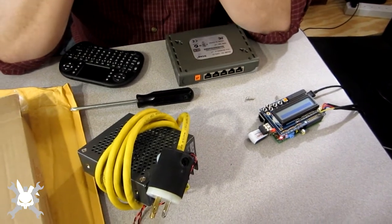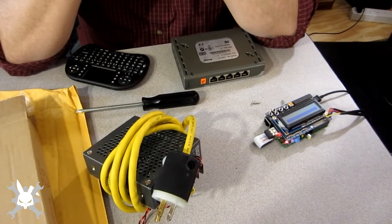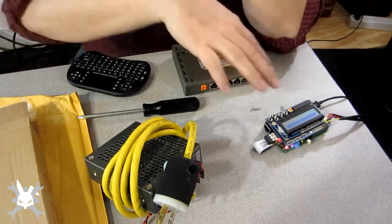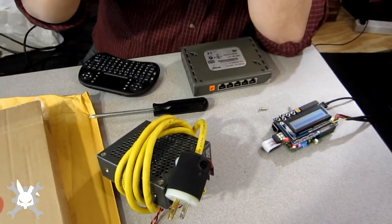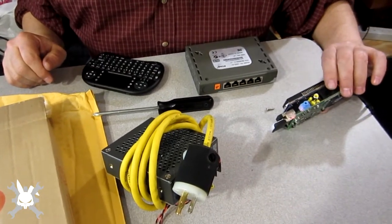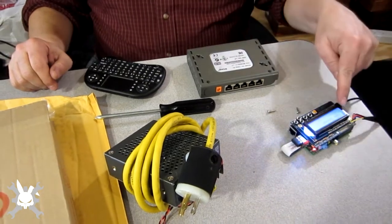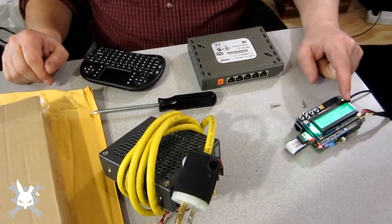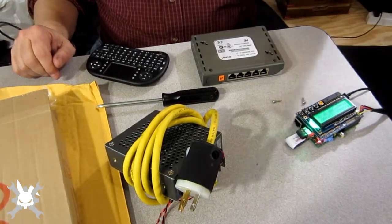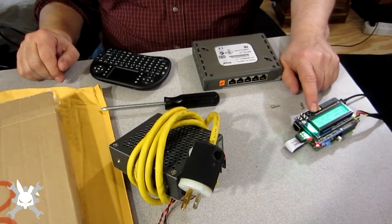So it reads a config file, and then it decides if the temperature is within the correct range. Then it's gonna be happy, and if it's not in the correct range, it changes the color of the display and sends a text message off. It's an RGB color, so it goes through all different colors. And then it says this is what the proper fridge temperature range is, this is the proper freezer temperature range is, and you just click OK to get going.